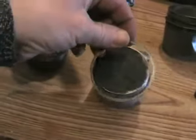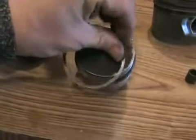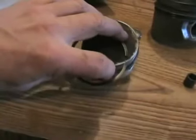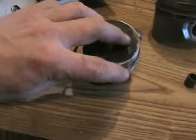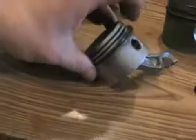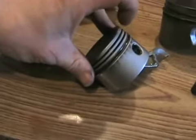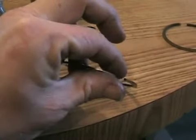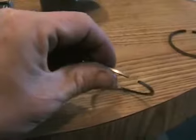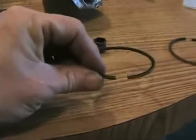When reinstalling your rings on an engine, don't just spread them open and try to drop them on — that's not how you do it. You sit it on top and push one corner down until that corner drops into the groove, then you twist and peel it on. Always start with the bottom ring first, then the second ring, then the top ring. Some rings have little angles or notches — always look on the package to see which direction to put the notch when reinstalling.